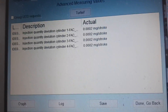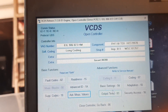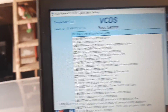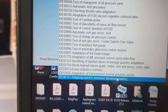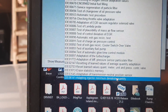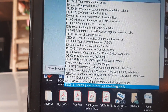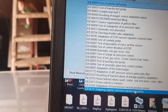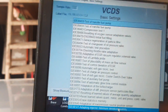There is an option for this. Switch off the engine and go into Basic Settings, select 'Adapting Injector Minimum Deviation Quantity.' There's a lot of confusion about using this. One issue is that if you select it straight away while the engine is running, the subroutine will run indefinitely — it'll ask you to press the brake and accelerator, go through its motions, and end up in an infinite loop without completing correctly.